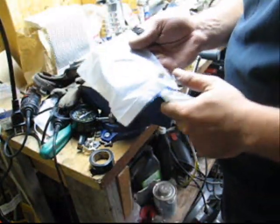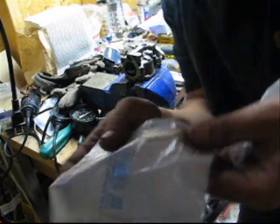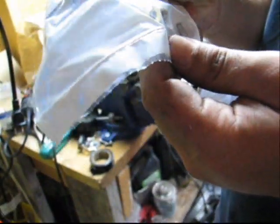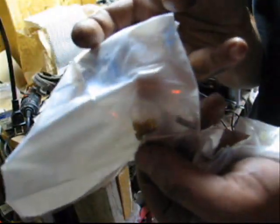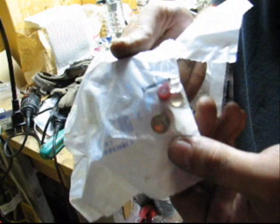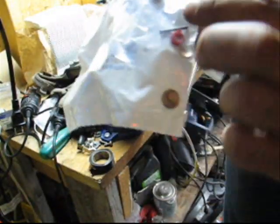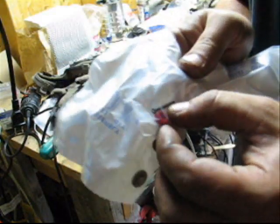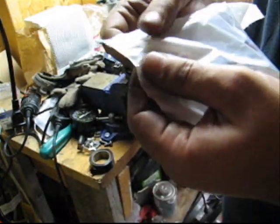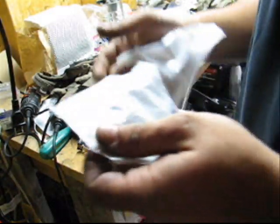These are the contents of your kit. This is an OMC kit, like I said. I don't know, the lighting's pretty bad in here. This one, that's your needle seat, clip, and gasket. They come in that one bag. Then there's your next bag. It comes with the retainer for your float, Welch plugs, and that rubber piece I was talking about. Now it comes in with the seat for the needle, but I generally don't change them out because they don't get damaged.